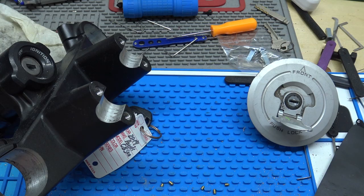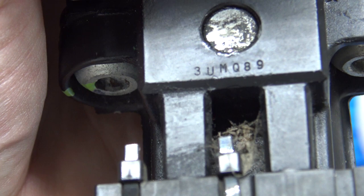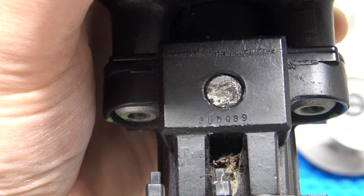Another little thing too — if somebody actually brought you one of these and they have the ignition off the bike, there is a code on it, but you can't see it when it's actually installed on the bike. It's right here by the fork lock, right above the spiderweb right there. It says Q89 — it's always the last three, so that's actually a code you can run through a code program and it will give you a code for it, but like I said you can't see that if it's on the bike.